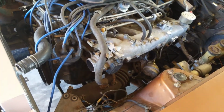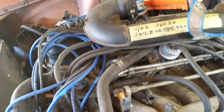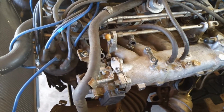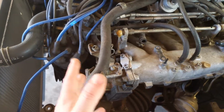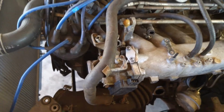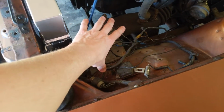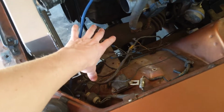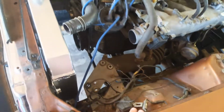I mean, on newer cars you don't have an, wow, I'm really just butchering this. An airflow meter. You actually have a throttle position sensor, or a mass airflow sensor, where it basically lets you know where the throttle's at at what time and how much air is coming in. It's a lot simpler than having the giant box that sat here, because that is originally on this L28 or 280Z, where the AFM would have sat, was right here. Like I said, I ordered a turbo one and it looks pretty similar, but I don't even understand where those went in the ZXs. I'll probably just have to look up some pictures and do some research.